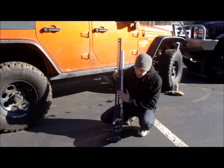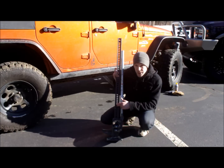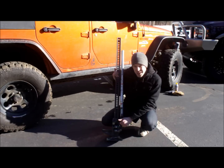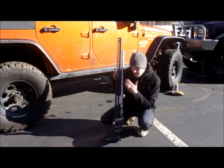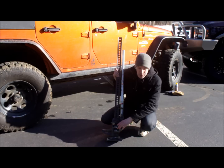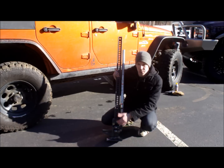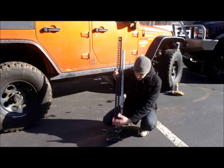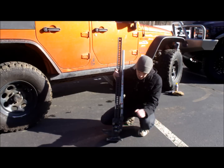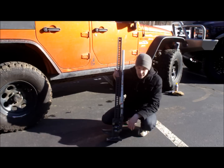So the different parts: we have the standard bar — that's the bar that runs up the whole middle of everything with the holes in it for the climbing pins to rest in. Handle, spring clip, this is your reversing lever — this is what makes it go up and down. Climbing pins — you can see here they have springs in them. Those are the pins that actually walk up these holes and back down when you jack up and down. This whole body is called the jack body, and then the nose of the jack and the base. All pretty simple — you don't really need to know the technical terms, but now you'll know what we're talking about.